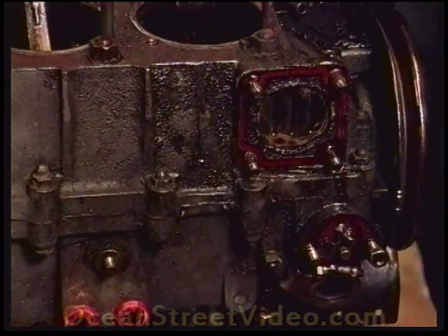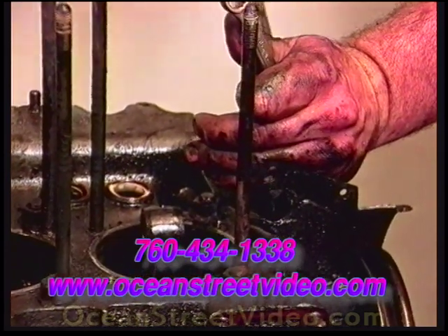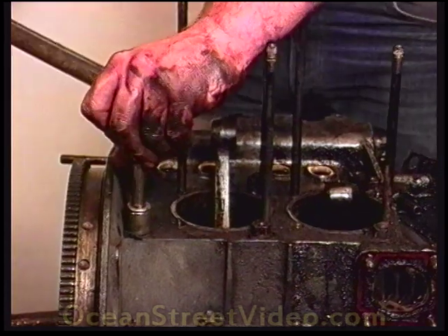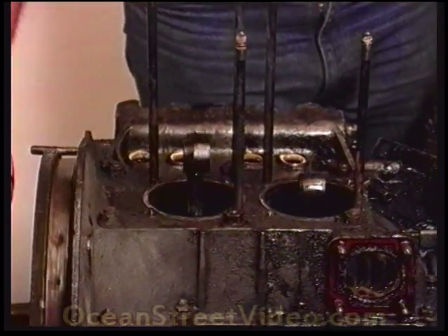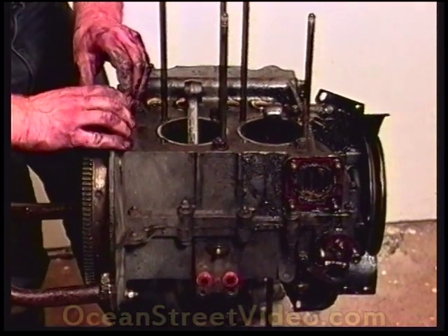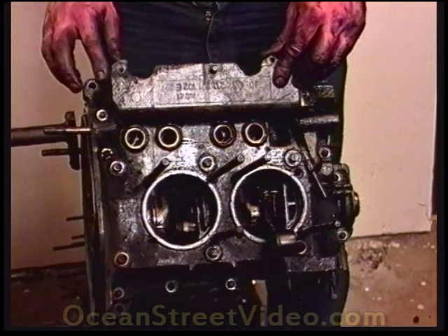The ones that are most critical are the long bolts down here — you should check these. It still rotates further and it's not binding at all. How about the thrust plate? Feels very good. When you do this, you want to get every single one of them. These ones are sometimes hidden in the oil and are forgotten about. Make sure you get them all.